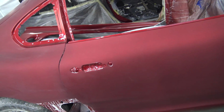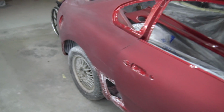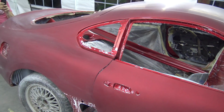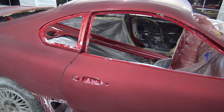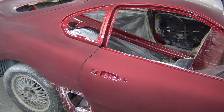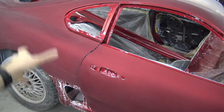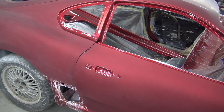I don't know. I guess I need to call around some. The other thing is I have a vinyl cutter, but the vinyl I have is really tacky, really sticky, and you're not supposed to do that over fresh paint. So there's a low tack vinyl that is specifically meant for stenciling and doing stuff like this, that doesn't react with the automotive solvents, supposedly. So we could have it printed in that, and then put it on here, and then paint the rest of it. So that's kind of the idea.